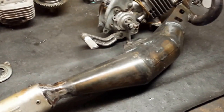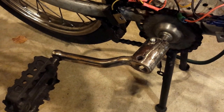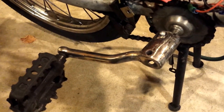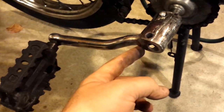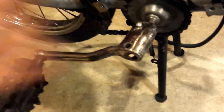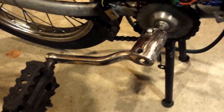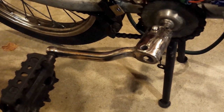Even doing that, I really didn't have enough space to clear the baffle with the pedal. So I had a spare pair of old pedals that I chopped right here and stacked them together. Welded it all together and smoothed it out with a flap wheel. That way I don't have to modify the shaft — if I change pipes and this becomes unnecessary, I can just put a normal pedal back on. That was an idea I got from Wheel Dollars, so thanks for that.